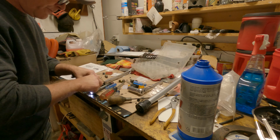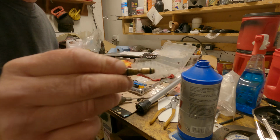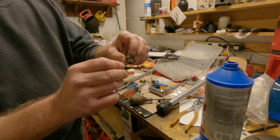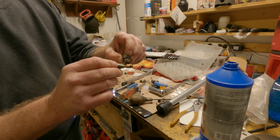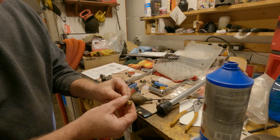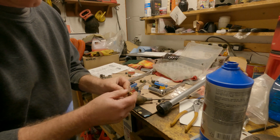Here's your shuttle that goes back and forth. You guys see where I'm at? You see what I'm showing here? Inside, if you lose pressure, one side will move, make contact, and turn your light on, and you'll probably notice you don't have brake pressure. Now this all slides into here. Of course, nothing wants to slide out after, what is it, 50 years this year.